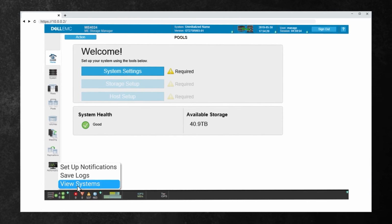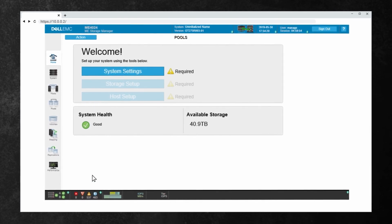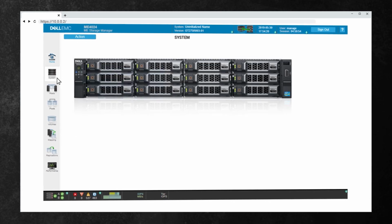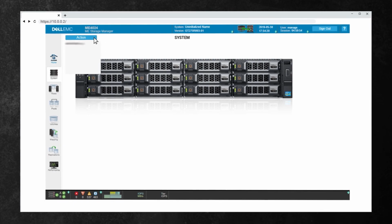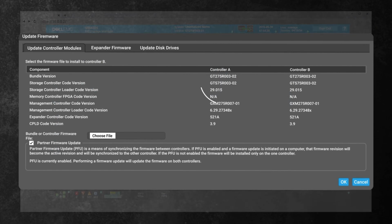Save another log file and then navigate back to Update Firmware to check the version has been updated successfully. If the firmware hasn't updated successfully, or both the values are different, you can contact us for technical support. There is a link in the description for a full in-depth guide to this process.